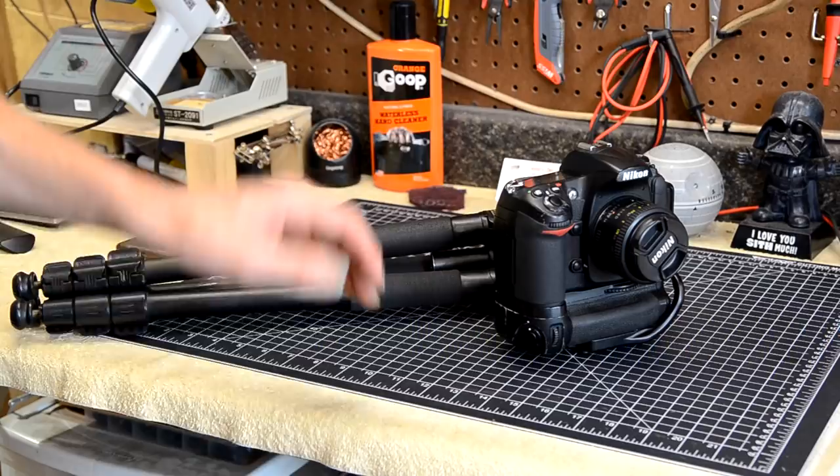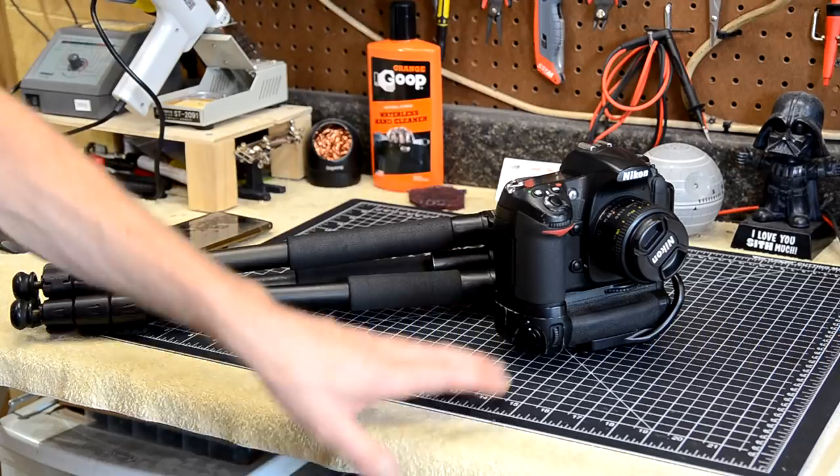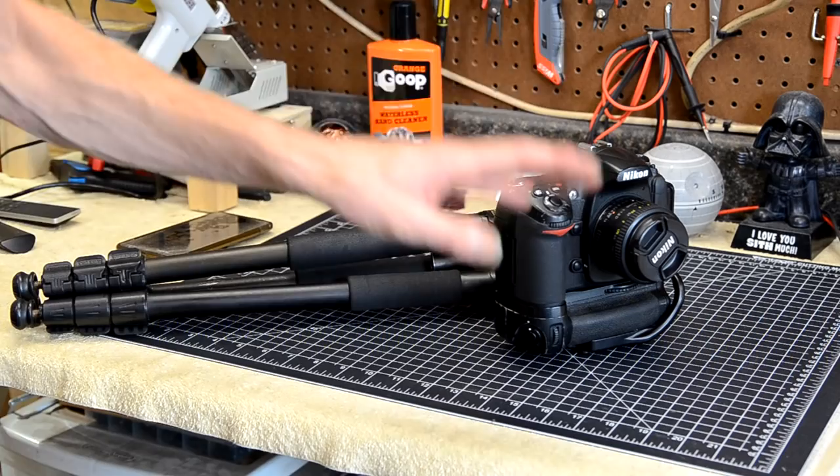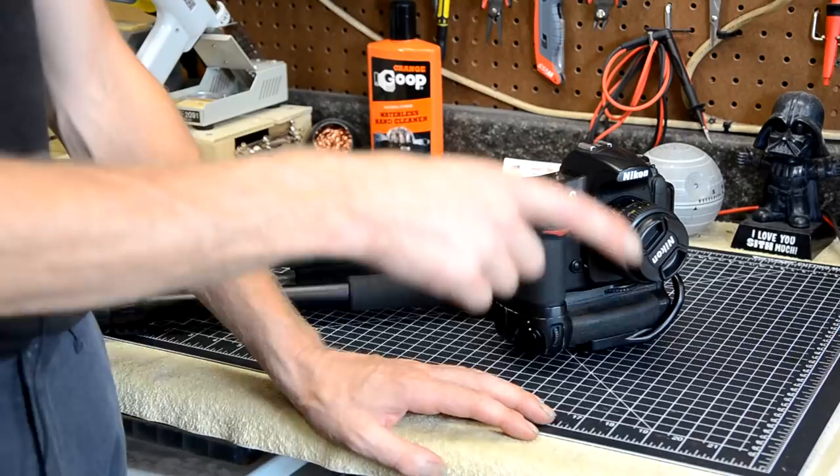All right, so the most important thing before you start tearing apart your playfield is to take a lot of pictures. And you're not just going to be taking pictures before you start tearing it apart. You're going to be taking pictures the whole time you're disassembling that playfield. Once you remove a plastic, you want to take a picture of the posts under that plastic so that when you go back to put it back together, you know exactly that post was there, that post was there. So taking pictures is really important.